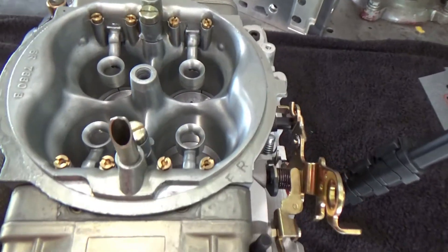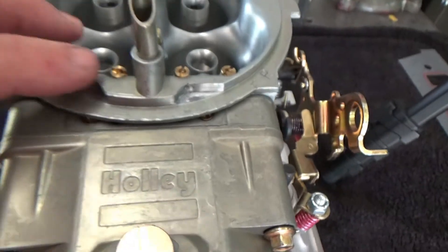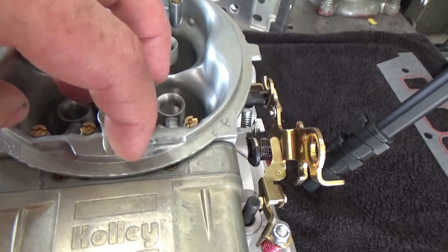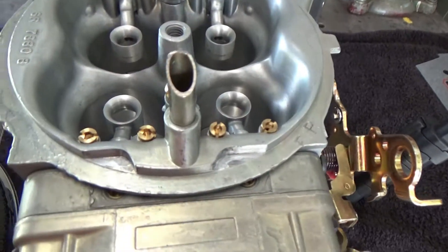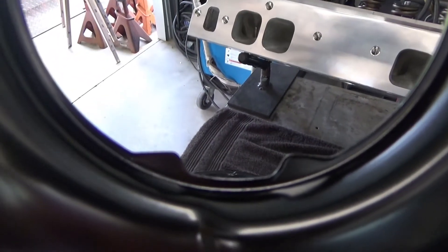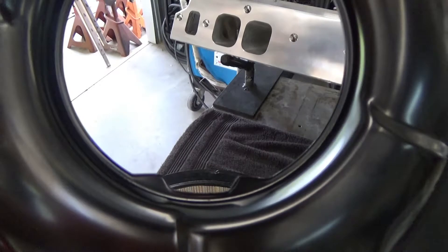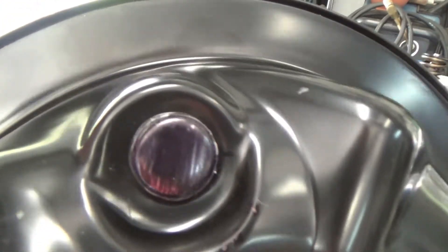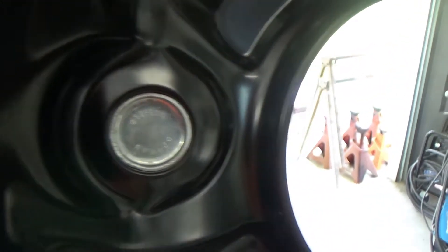On the carburetor itself, I was able to put it in my milling machine and machine those slots right there — see those slots? That keeps the air cleaner lid clocked correctly. Those two indentions over the fuel float adjustments of the Holley keep everything in line. It was advertised that it wouldn't fit with the dual line coming out of a Holley, so I removed that pipe and found a freeze plug to put in place of where that bigger hose came out of the air cleaner lid.